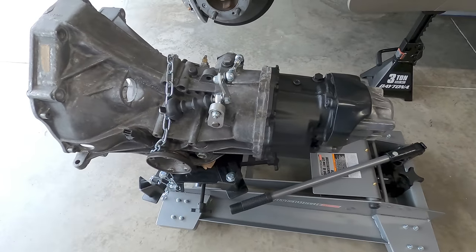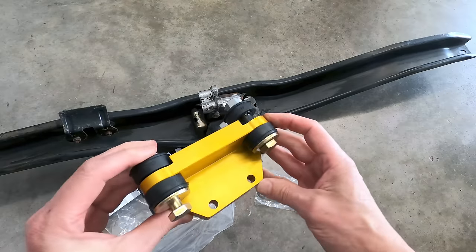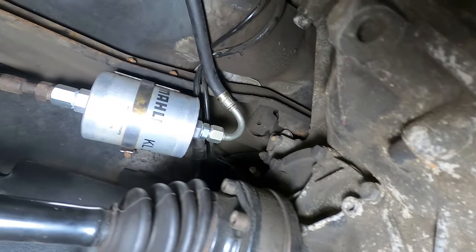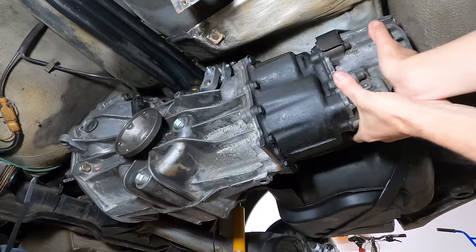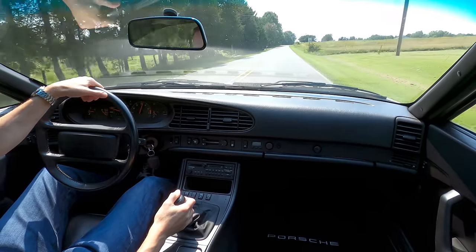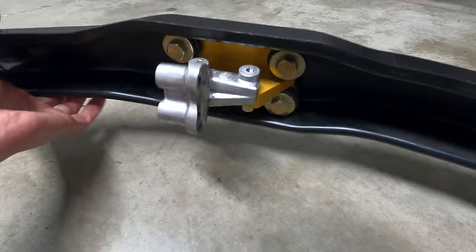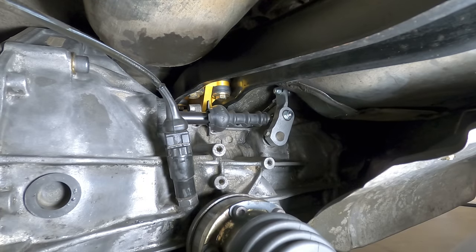When I was reinstalling the transaxle on the car, I decided to replace the worn transmission mount with Lindsey Racing's ultra mount, as it was comparatively priced to the OEM version while boasting some interesting benefits. This mount is similar to a solid transmission mount, but it applies four rubber vibration isolators between the mount and the transmission support hanger. With an old rubber mount that's aged out, the transaxle gets a lot of abuse hanging in the back while it sloshes back and forth when cornering. The ultra mount provides a fixed connection, eliminating movement in the driveline and allowing for cleaner power delivery to the wheels. The effect does slightly amplify transmission noise within the cabin, where gear changes are now more pronounced, adding to the symphony of other engine and exhaust sounds. Feedback through the shift lever is more distinct, and I've noticed the rear of the car is more stable and predictable in the corners.